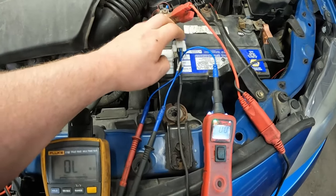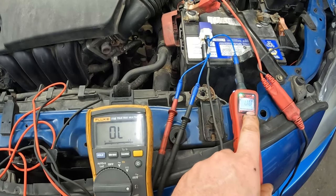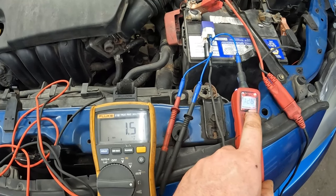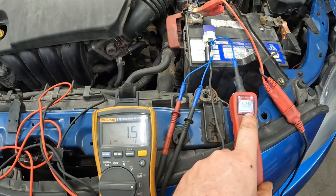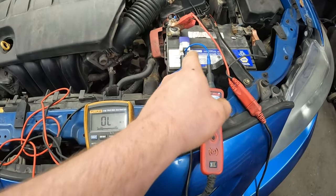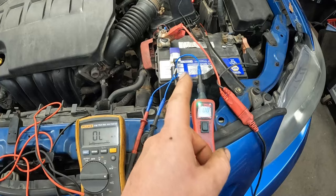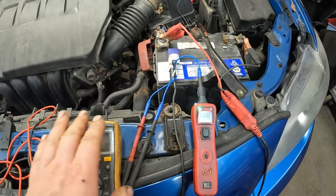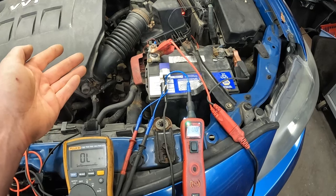Now, see if we give it some taps. When I first checked this, I pulled it out of the car, before I had a chance to do the clip of it, the video, I was getting around 9 ohms. So that is not a good relay. Let me clear this out. I'll pop that cover off and let's just see if we see anything.